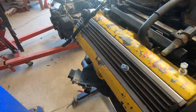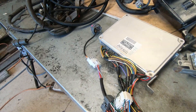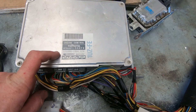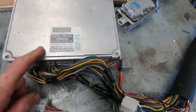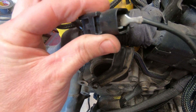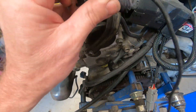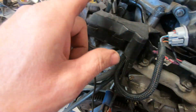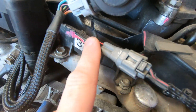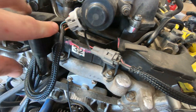Did I mention this was a really early ECU? Like 91, 92 LS400 — very, very early one. So we work our way up the loom. I've used a standard series of plug, not actually off the LS — it's off a later model LS with the three pins. Stepper motor is now on the back, and I've given this cover a bit of a trim so it can all fit out nicely and it can clear the stepper.